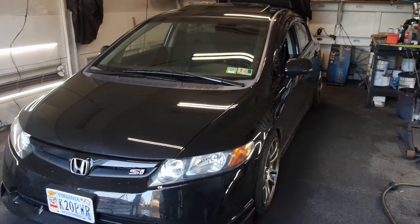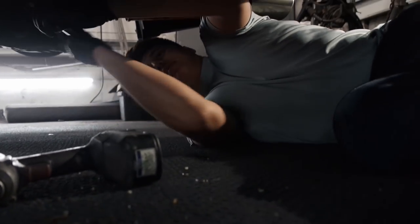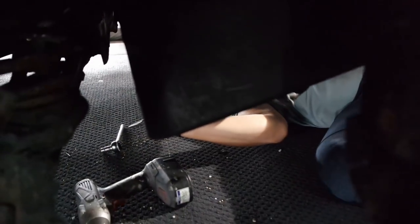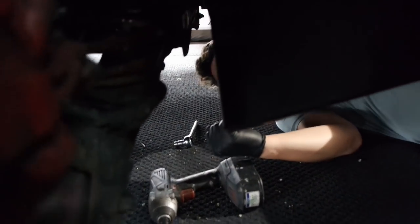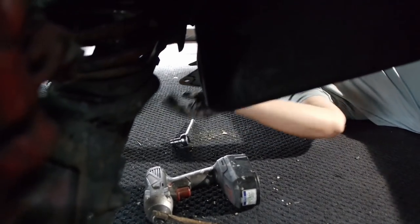Right now we're working on the back first. My man Oscar is wrenching away on his own car. We're working on the back — basically you need to take off this cover. There's a cover over a bolt that you can't even see, and we have to remove that cover to get to the bolt. We need to loosen that bolt to get the lower control arm down so we can actually get the spring out.